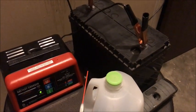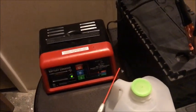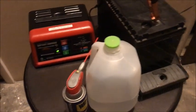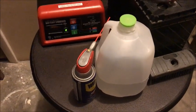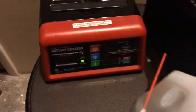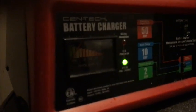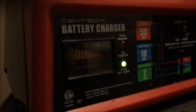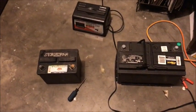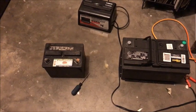So that's what you need — you condition the battery, clean it up really well, get the terminals nice and clean, refill it with distilled water, then recharge it with the battery charger. In this case it took about three hours to charge, and it did recharge because I have a quick charge feature on mine.